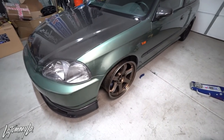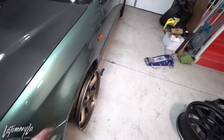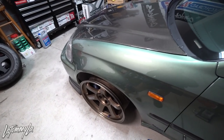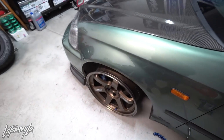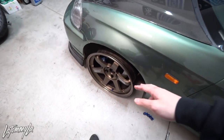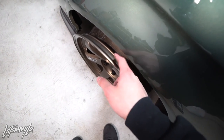I kind of want to keep the OEM body line. I'm not stretching these wheels. The new fenders I'm picking up are roughly 40 to 50 millimeters wider — the stock fender is roughly an inch, which is 25 millimeters — so the fenders are gonna arch over these tires, which is perfect because it'll allow me to turn at this ride height running a 235 on such a wide wheel. I'm mainly waiting for those fenders to come in so I can slap them on, and then I'll go ahead and order the Falken tires.